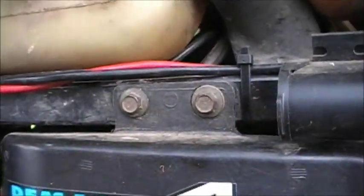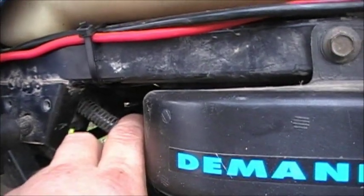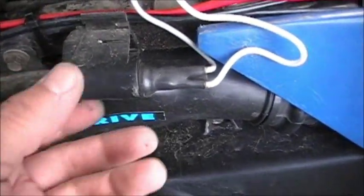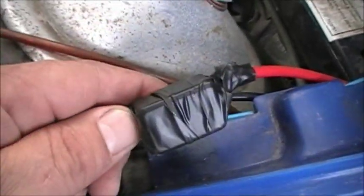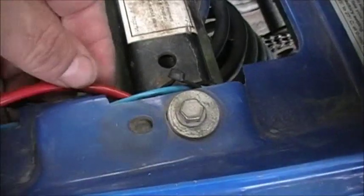I strapped it up for now — I'm going to get some more coil wrap and do it right, just got to go pick some up. I added a cigarette lighter, which was a quick little thing. I wrapped my solenoid box, and there's a relay back here that I wrapped too because they didn't give me anything to wrap it with. I went right back in here and it connected perfectly to the battery. I've got a lot of stuff connected — not as many grounds but more hot wires for various things.